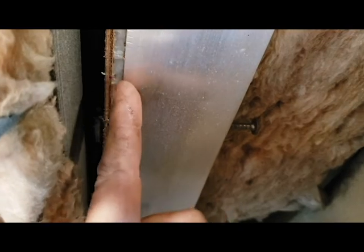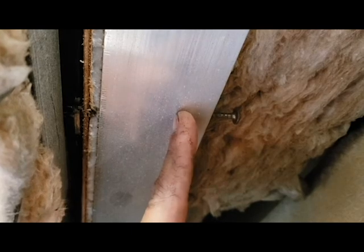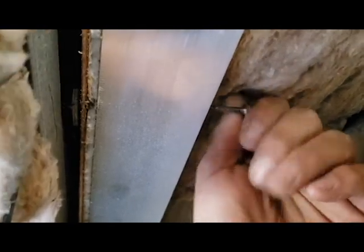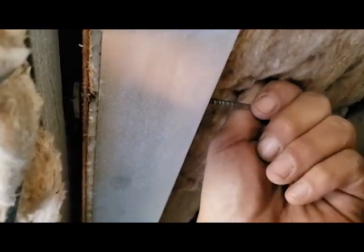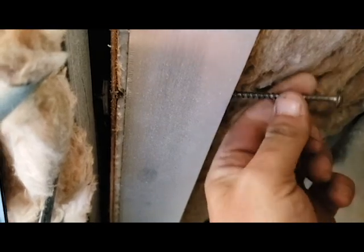When you drop your spare tire and your spare tire carrier, you're going to be looking at this. There's your license plate hole there. What you're going to see here is a piece of aluminum rectangle channel. Right here is your floor, behind this joist. This piece of foam you see here with a little bit of material on the side — that's your wall. This is a support piece attached to the rear cap. This screw you see right here is broken or backed completely out — I'm going to screw it out live on camera. This is all that DRV uses to secure the rear cap to the floor: these three long wood screws.